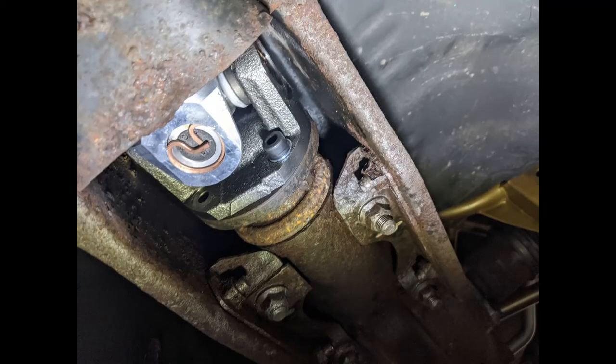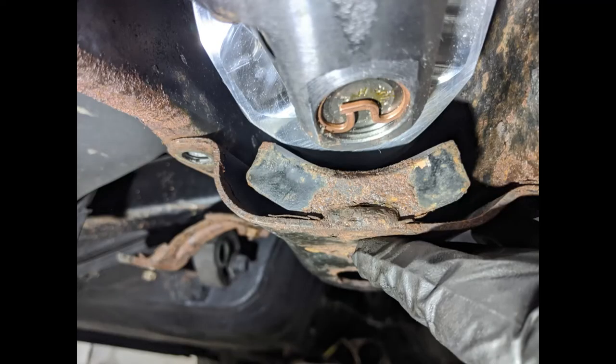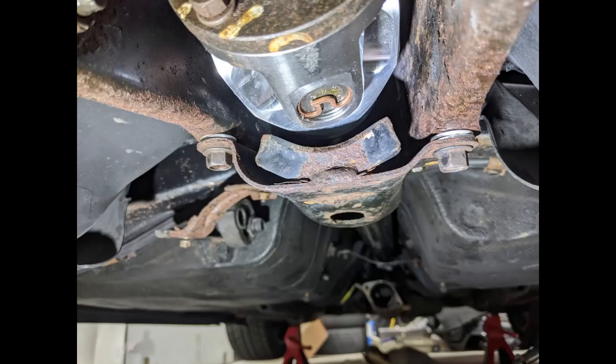The next thing I found is that the clearance between the lower diff cover or counterweight and the shaft U-joint is almost non-existent — that's not camera magic, that's the actual space I have between the two. The last thing you want your U-joint to do is run into a static object at highway speed — that wouldn't be a good day. So for the rearmost bolts on the lower cover I just added some washers and they worked as shims, which shouldn't negatively affect the rigidity of the system and will definitely give me peace of mind when launching or at highway speed.